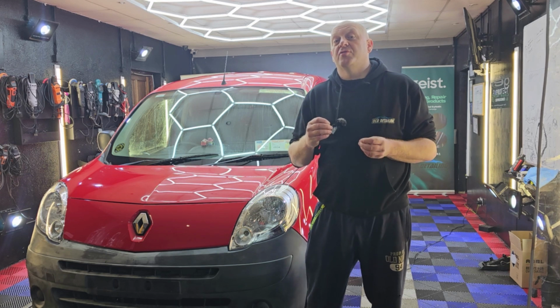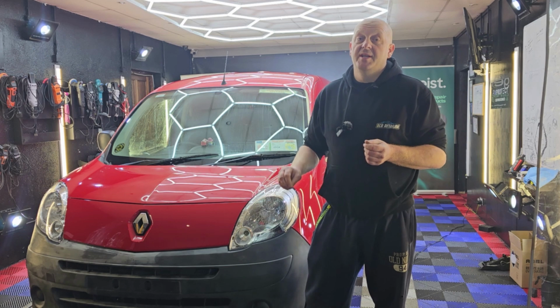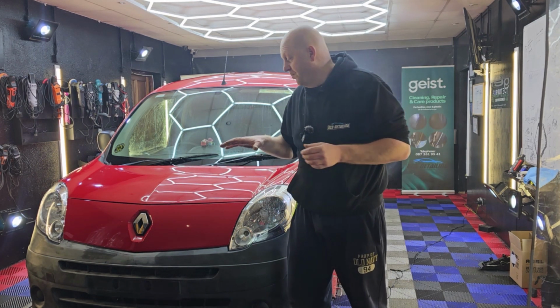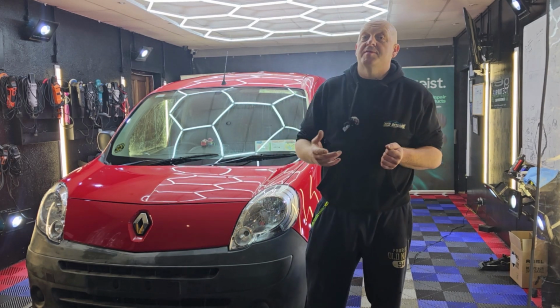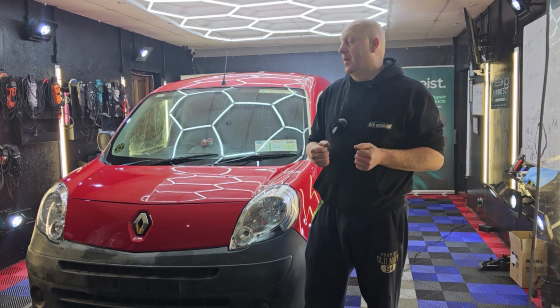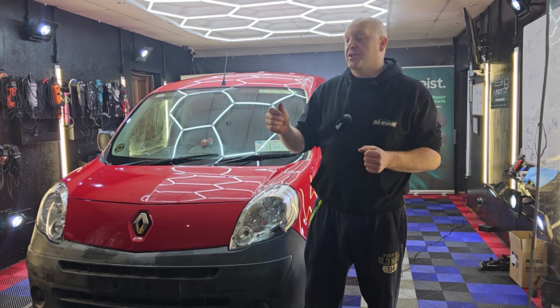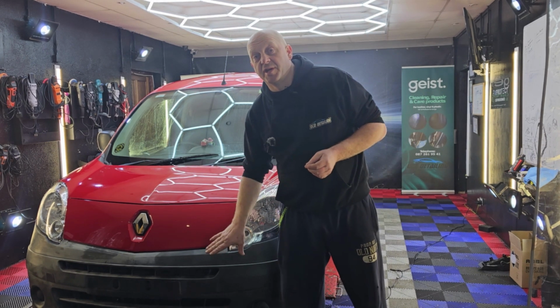However, if you are trying to restore trims this way, always make sure you do a little test first and use water-based compounds. So now I'm going to finish polishing the trim. Probably sounds weird, but that's what I'm gonna do. Then I will use panel wipe to remove any excess of the compound. Then when we finish the full vehicle, we will rewash it. After that we'll dry it, and then I will apply trim restorer.